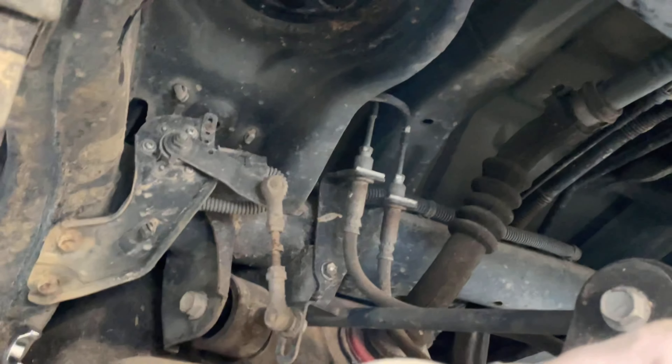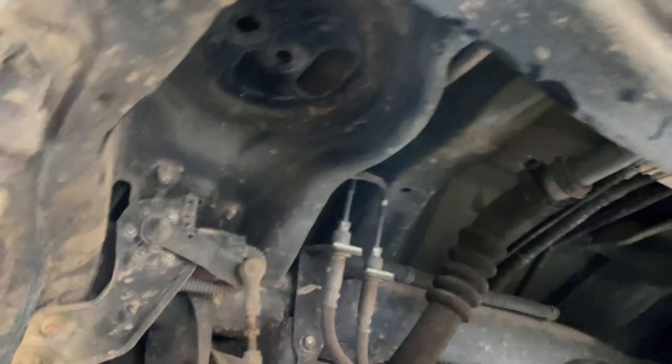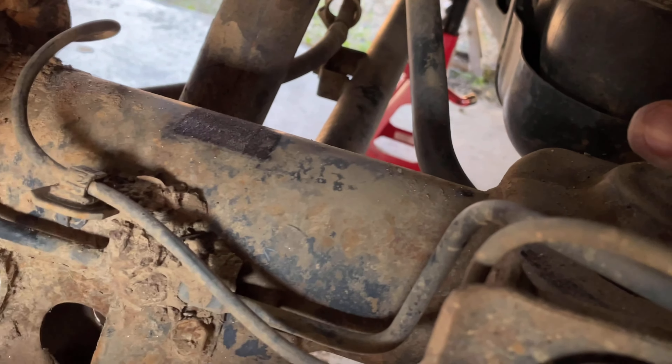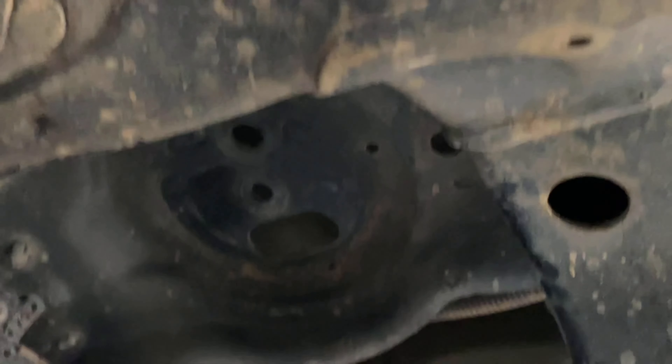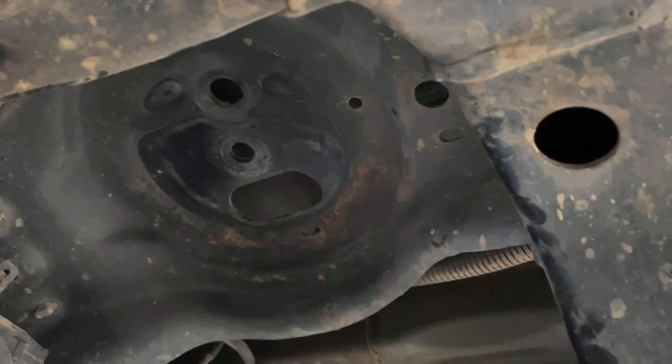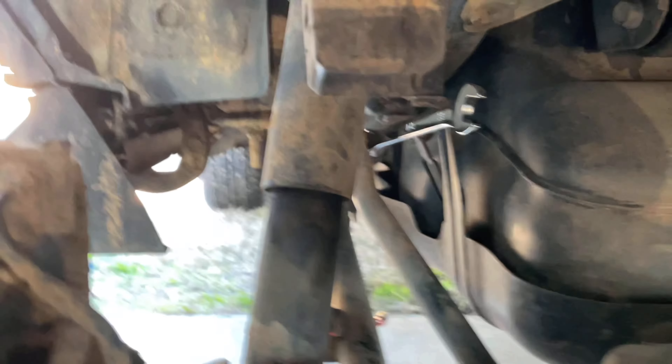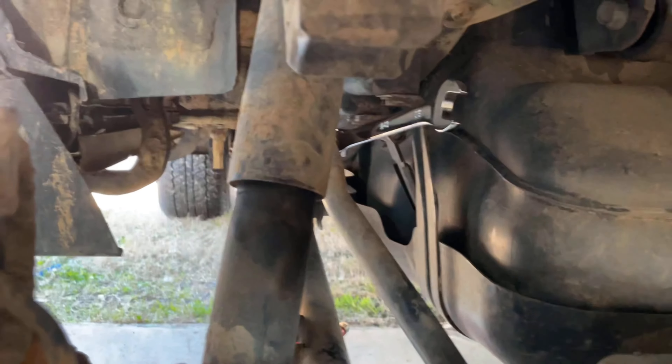Now that that's gone, that hole is where the upper isolator will go. And then the fun part is getting the lower isolator in here because you have to thread in the nut and washer from the bottom side and the bolt and the isolator going from the top. So a little bit of a booger, but this is where they'll sit. That hole where the spring just came out of — the middle one — is where the new isolator bolt will go in, and you'll thread in the nylon nut from the top. I've got to look back at the torque specs to see how much they are. That's where we move next after we finish taking the sway bar loose and getting this shock or original strut out of the way.